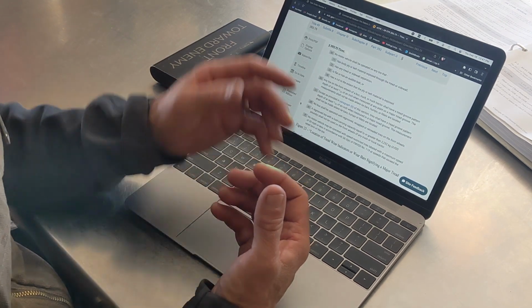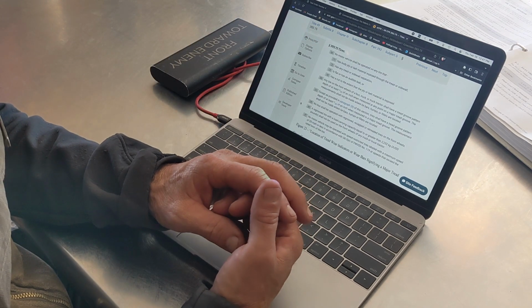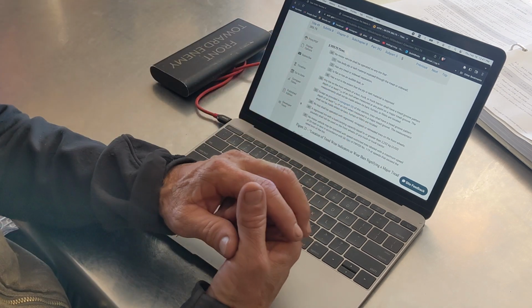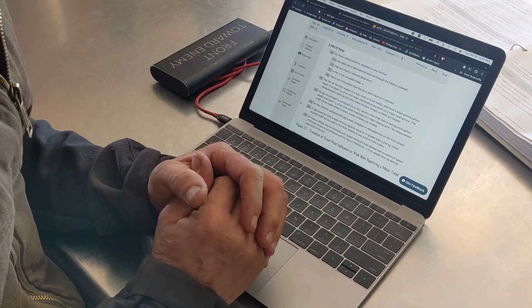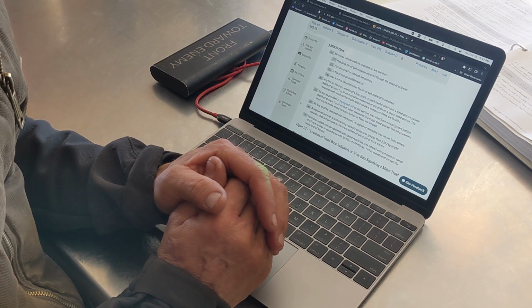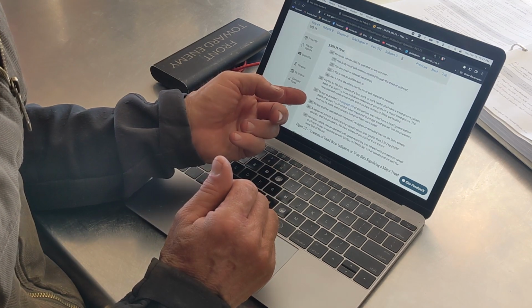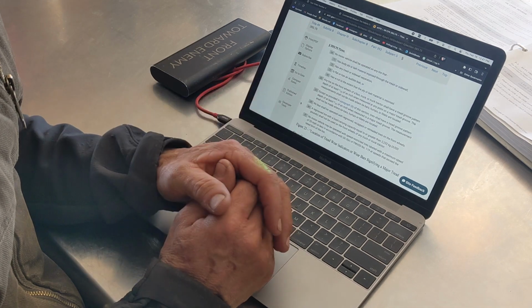Is it legal to do? Well, CFR, the Code of Federal Regulations 393.75, says that no bus shall be operated with regrooved, recapped, or retreaded tires on the front wheels. Well, guess what? Your skoolie, once you've taken all the seats out and you're not operating it for carrying passengers, is no longer a bus by definition, not federally or in any state that I've found. So your skoolie conversion is no longer a bus. So you can legally use recapped tires on the front.